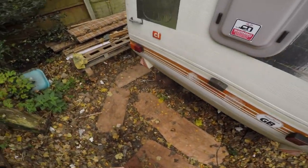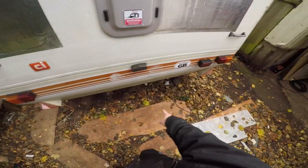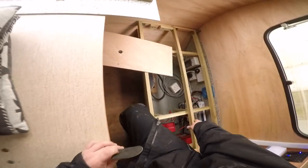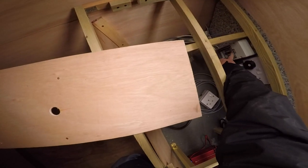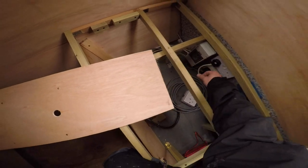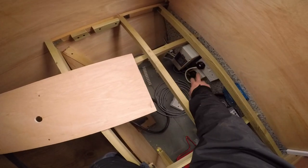There's been massive work done. As you can see there's a 16-amp connector there - the caravan has power to it, I don't need to run it through the window now. There's power running to this fuse here, that's an RCD, so like when there's a short to ground or stuff like that it pops up.